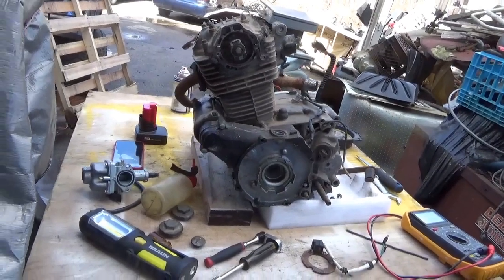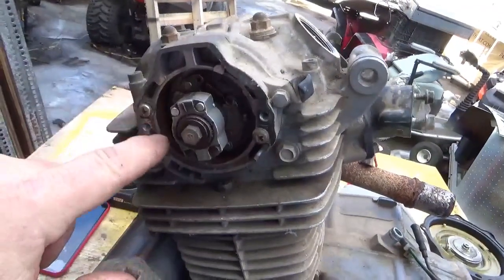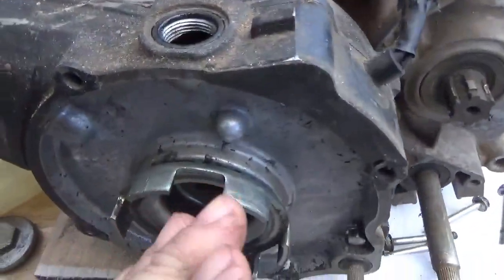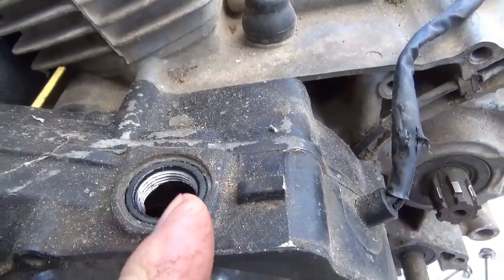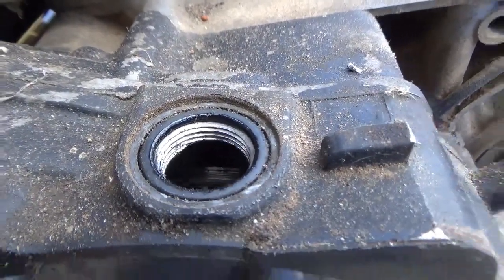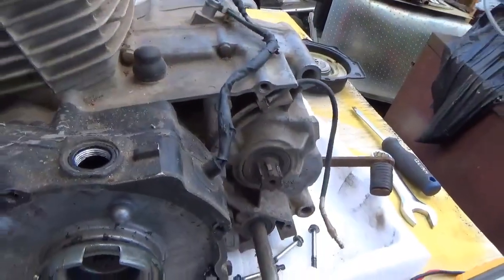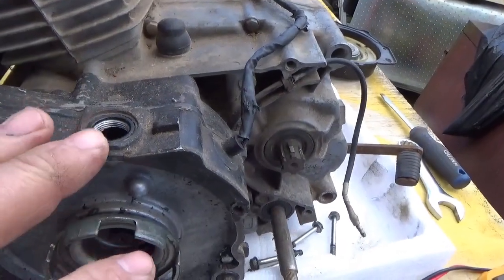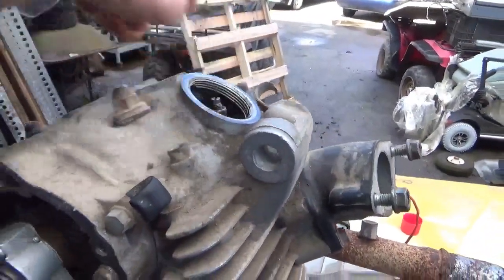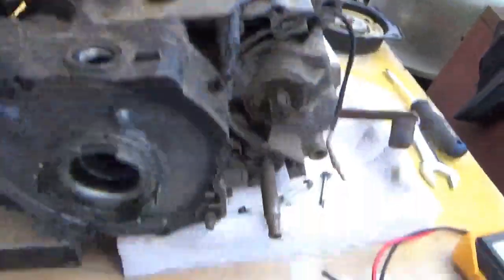First of all, you want to make sure that it's more or less complete. I've got to put the ignition in here, and since I have to put that in, I've got to time it up. So I spun the flywheel around such that the top dead center mark — hopefully you guys can see the line — lines up with that heavy line. That's going to take you a few minutes with a flashlight to get all lined up. You also want to make sure your valves are loose. We did that, so we're at top dead center.